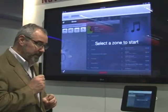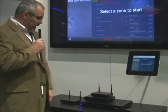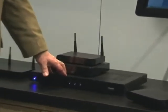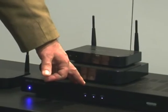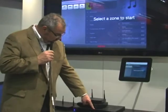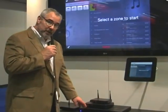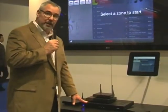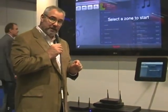It is indeed wireless. Here are the pieces of the system and it consists of the ability to do amplification in zones in a completely independent fashion. It's the way we've always done audio. One of the pieces that's very popular in this system with the custom installation community is this one on the bottom here. This is a three-output, three-zone device. Each zone is 40 watts and they're independent outputs. So I can put this in one location, have it wired to speakers through the home, very much like we've always done our traditionally wired systems.